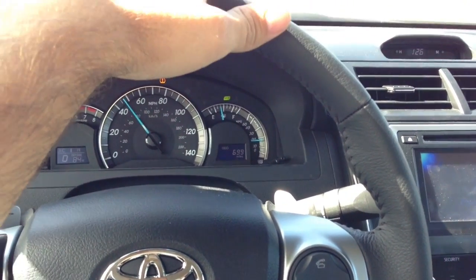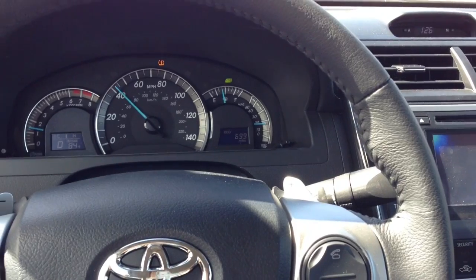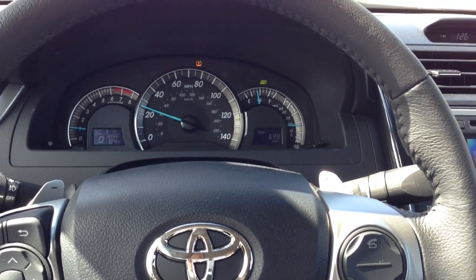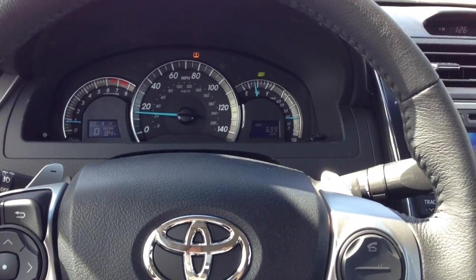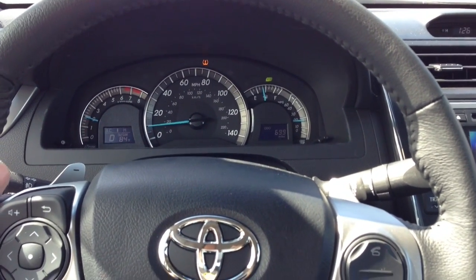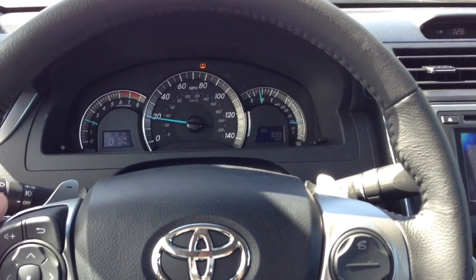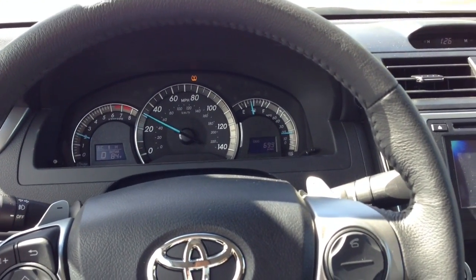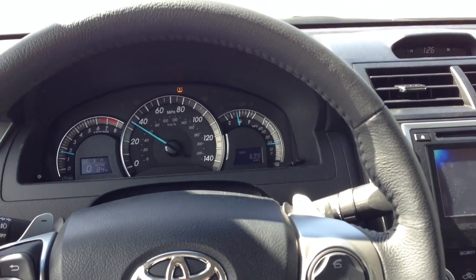You know, it all depends on what you want to hear, but at the same time, this will increase miles per gallon. I have a Toyota Corolla. I did the same thing. You can honestly do this to any car. Just look at where the restrictions are. Cut the restrictions out. Those restrictions are there not to increase gas mileage. They're there to quiet the engine down. If you don't care about that, then it shouldn't be a big deal to cut them out.